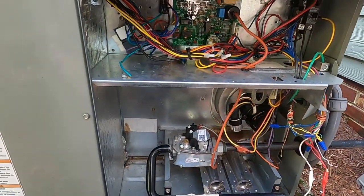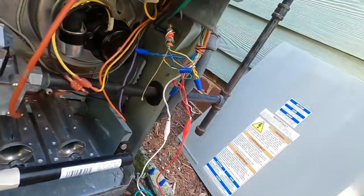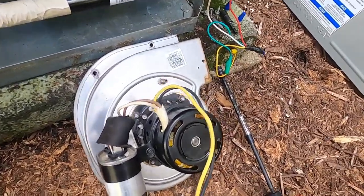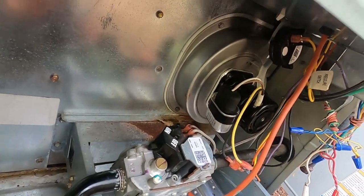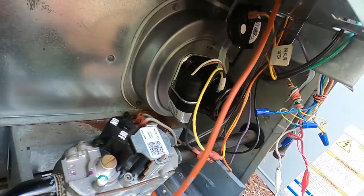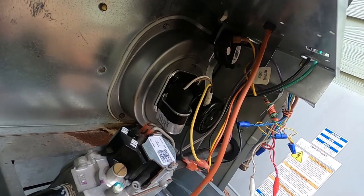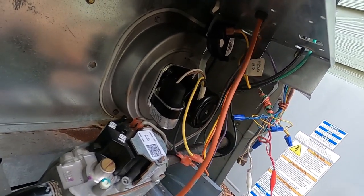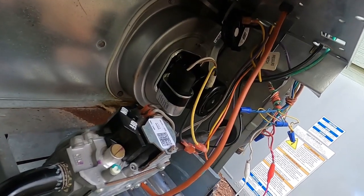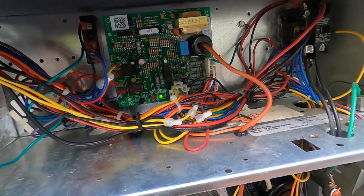Anyway guys, I wish I could have made it one video and not two, but it threw me off with that little change in that motor. Other than that, it's the same motor. Just that hose port — so keep in mind there's two different versions of these package units. One has the hose that plugs to the front face plate on your heat exchanger, one plugs to the motor. Be aware of that before you take one apart and realize you have the wrong part going back in. It happens to the best of us. Like, subscribe, appreciate you watching, and we'll see you next time.